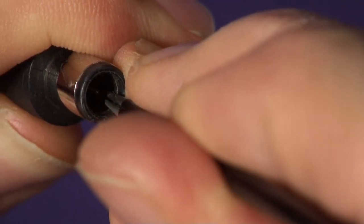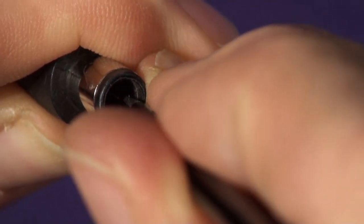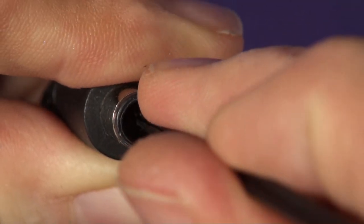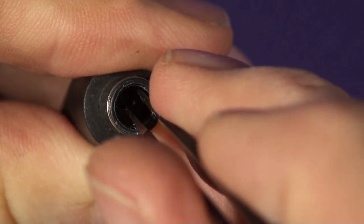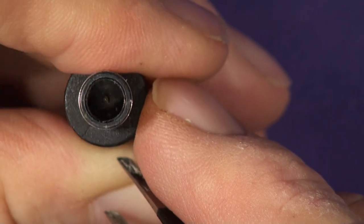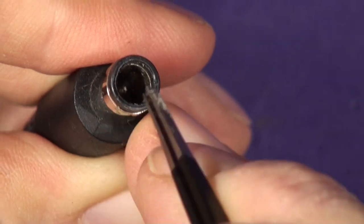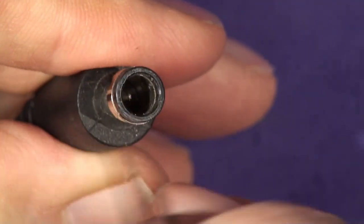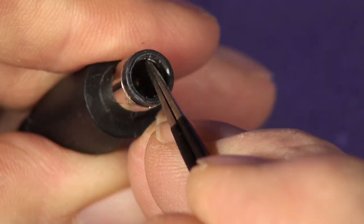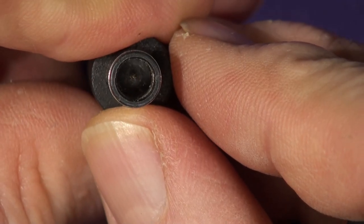The name of the game here is to straighten it up. It may snap off but generally speaking, if it's only been bent once and not too violently, it will survive. Bend it back, hold it and straighten the pin so it's sitting dead centre. The pin should be about five millimetres below the ledge of this lip. That's 0V, that's minus 18V, and the inside ring is plus 18V — so it's an annular connector with three electrodes. So that's straight, that should work, and I've repaired the test power supply.